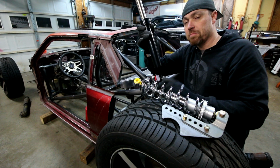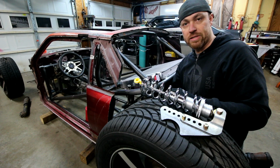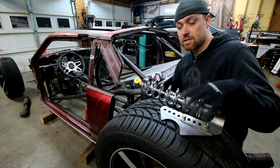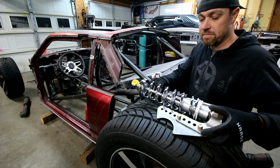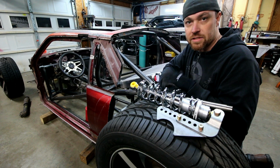Whatever happens, this will go down here on the inside, with a cantilever lever that attaches to it on the outside. Pretty simple. When the hydraulic cylinder pushes up, it'll push down on the shock, lifting the car to its ride height, which can be adjusted via these however I need to. Pretty simple, right? So that's what I need to get to working on. One of the first things is to bend a couple bars and make some mounts for this four link setup, which will be all half inch, inch and a half chrome moly tube. I've got inserts and heim joints for that. So I just have to make those mounting points and then I can move on to this stuff.